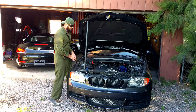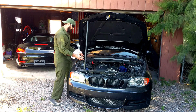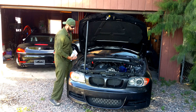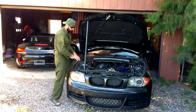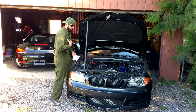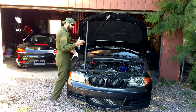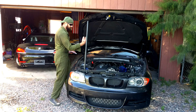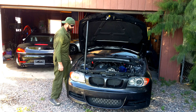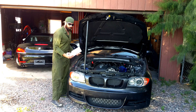I think that's even a step up from the bottom single mount turbo personally. You could probably get more power with the precision 6766, but I don't know if it's more usable power. The Vargas game changer turbos are the way to go for twin turbos. Of course you've got the Pure and the RV turbos too, but my personal preference is the Vargas game changers. When you go to larger turbos, you're going to need more fuel — so you're going to have to get the Fuel-it or a manifold fuel system, and a hopped up low pressure fuel pump, which is pretty easy and pretty cheap.